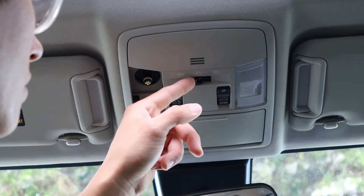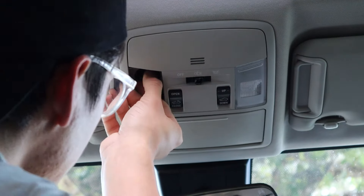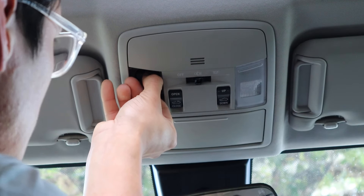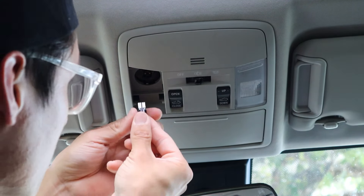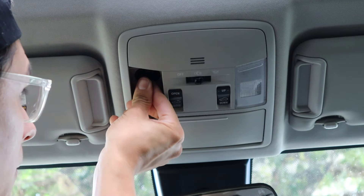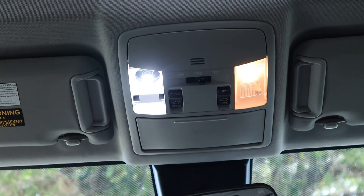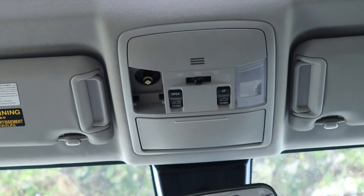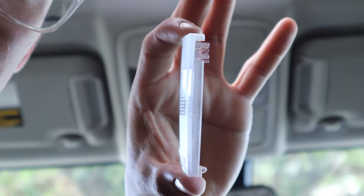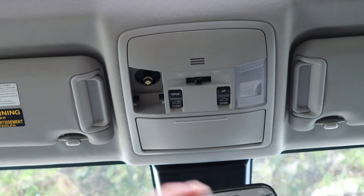If you want to test it out, you can turn on your little switch on the RAV4. As you can see, this one isn't illuminating, so that can mean one of two things: one, you didn't push it all the way in, or two, you simply just have to flip it around. There's a difference right there already, so that one's working. This is a really thick piece of plastic that Toyota made, so it's pretty sturdy compared to the other ones I've seen.